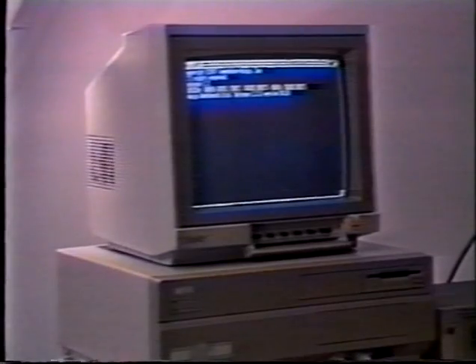You can safely turn on the power to the components to check and see if you have continuity — a display on your RGB monitor. If you have an auto-booting hard drive, you should see the boot sequence happening. If you don't, your workbench prompt is looking at you. Now let's connect the remaining video cables. By video cables, we mean 75-ohm video cables, not audio cables. Interference and impedance are very important when dealing with video signals. To be on the safe side, let's turn the power off before connecting the remaining video cables.